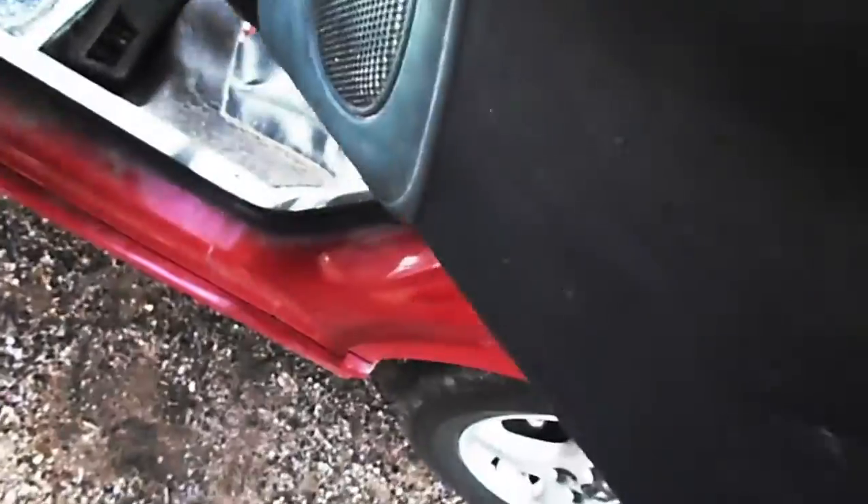After that you put it back together. First step in reassembly: take this back deck cover and put it back in — it's not that hard to reinstall. You put the back up there, push these clips back in, put your seatbelt back through, then do the same on the other side. I don't seem to have a clip anymore, but you still pull your seatbelt through and push it back tight.